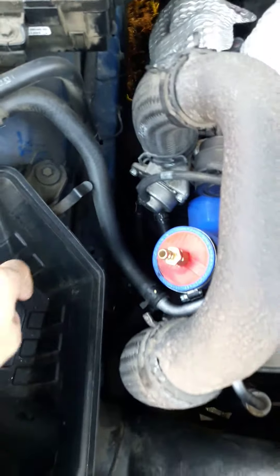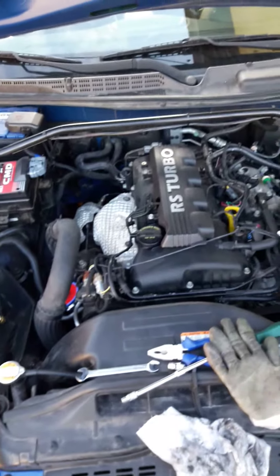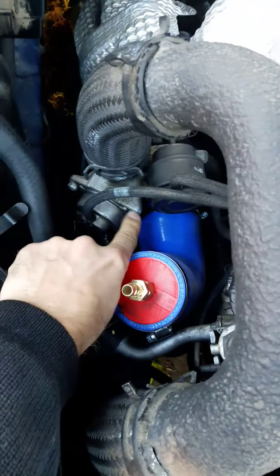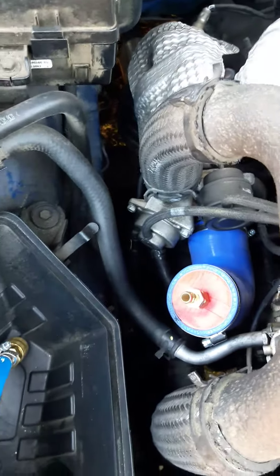Do your compressor check because I had erratic boost pressures and lack of power. One of the reasons is the leak over here, and supposedly this is a common problem with the Coupe. Check that out if you can — hope this helps.